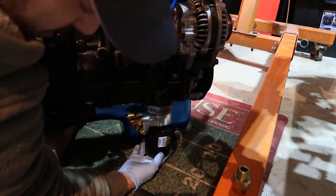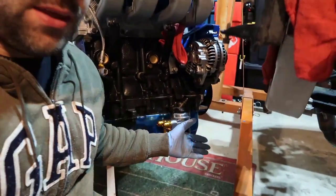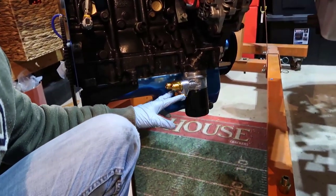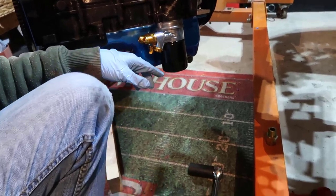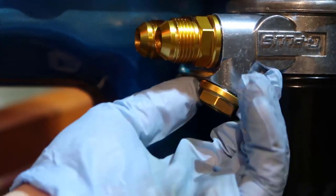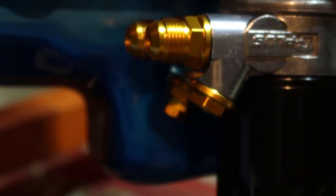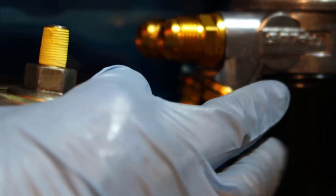Here's the filter — it's a Dodge Neon filter. This is how we install the sandwich. It was a little trickier because it has a thermostat and extra ports. I ended up using my own o-rings, and as you can see they're slightly proud of the surface — I can see and feel them sticking out. I'm pretty sure when they start failing this will start leaking, so I think the thinner o-rings from the kit might actually be the correct ones. I'm not positive though.